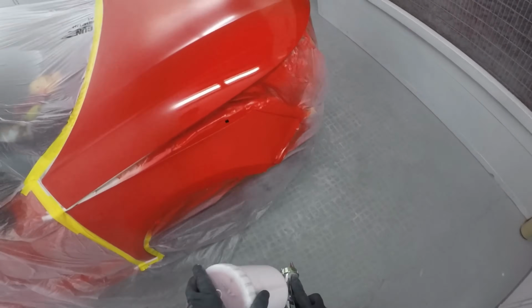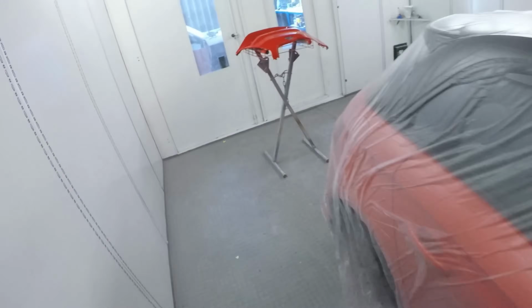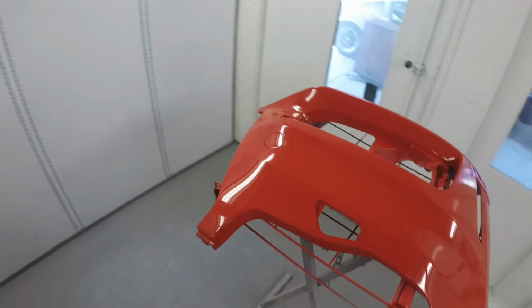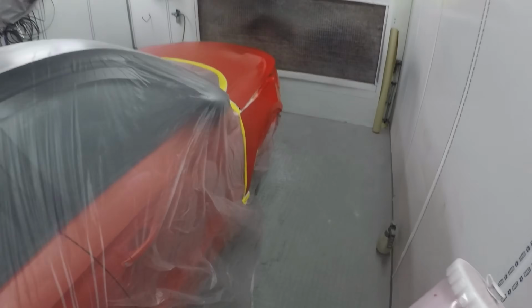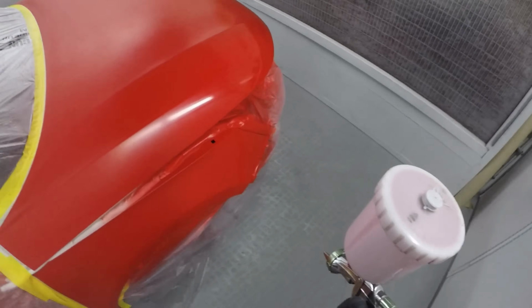So we were getting a little bit tight on the actual paint on this, but we did make it through luckily on this job. I think I only had a little small 1/4 litre mix for this job. So even on the Pearl Red, it's not something that you're going to need to buy a bucket full of paint for. I had about 100 ml of the ground coat, and then mixed that 2 to 1, which was more than enough to cover everything up to white. And then I had a little 1/4 mix of the red, because reds generally, as a rule of thumb, are pretty poor for coverage.